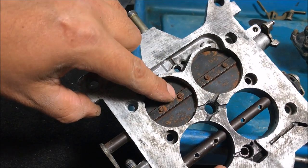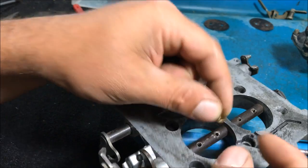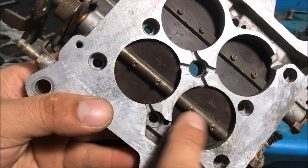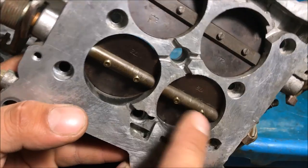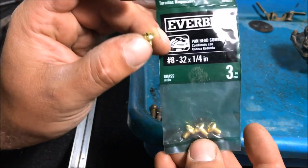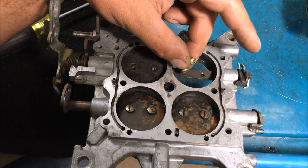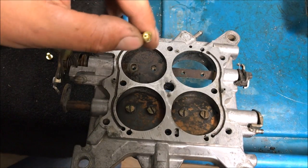Now that we've done a professional repair we need to do the same with these butterfly valves. The old screws had that little pattern stamped and squished on the outside — if you try to run them out or they come out on their own, they'll drop in your engine. I had to completely grind these off. We're going to borrow some screws from another base plate — these came out pretty easy without damage. I did order some but they also sell some of these screws at Home Depot. It's very important you address this because if the screw falls in your engine you're in big trouble.